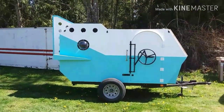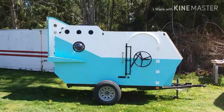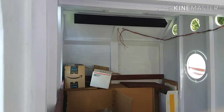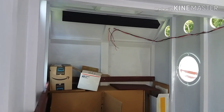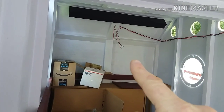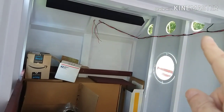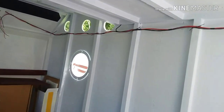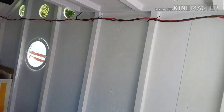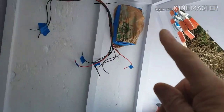That's what it looks like right now. I just started on the inside getting the electrical run. This here is a three-foot sound bar that runs on 16 volts, so I'm using a DC-to-DC step-up converter to run it. All these wires are pretty thick — I've got split wire loom ordered but it's not here yet to cover them. I could have just run positive lines to everything with a common ground, but I decided to run individual wires to everything. The charge controller got covered because there's cutting and sanding out here and I didn't want debris getting in there.